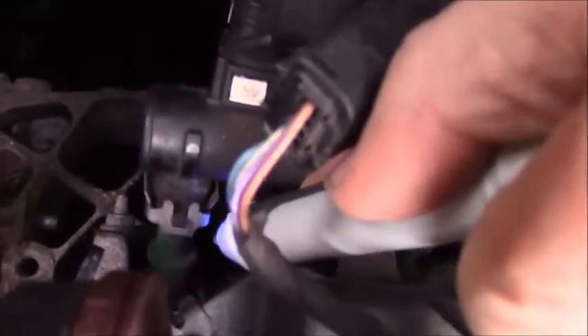You can't really get wires down to them, so that's part of why this tool is useful. There you go — that's showing me the injector firing, and now the coil. Second injector and the coil. Third one's really hard to get to. Fourth one flashing on and off, and the coil.